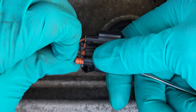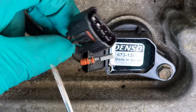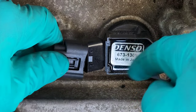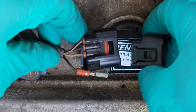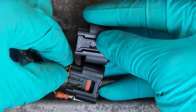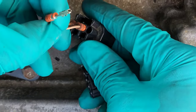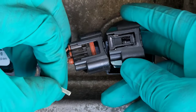Pull the wire and you see the pin comes right out. From here, I suggest you always make sure your new connector works — make sure you plug it in and make sure it fits before you start disassembling the old one. You want to line it up so you can see this is exactly how it goes.